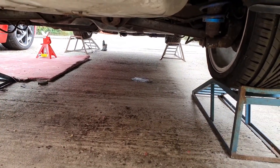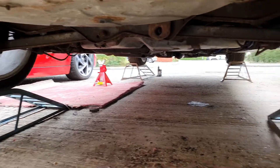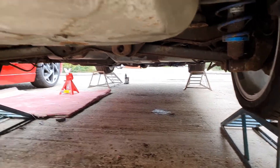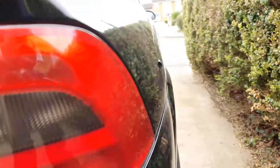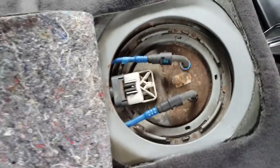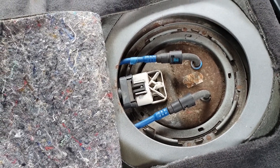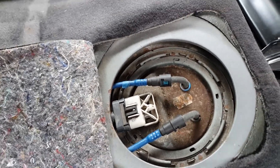Good news — can't see any fuel leaks at all under there, it's all clear around the filter. That is water dripping out of there. I think it's getting in through the boot seals because these hatchback Vectras are notorious for the seals around the boot lid going. So I think that's probably where that's getting in — we need to investigate that because it's quite a long way down the front of the car. Everything's connected up, and there don't appear to be any leaks, though obviously I won't be able to tell a hundred percent until the car is started, and I can't do that until the exhaust system's fitted.